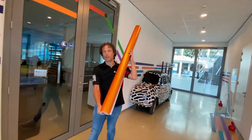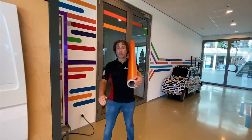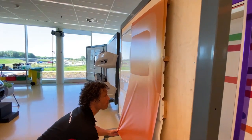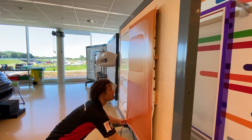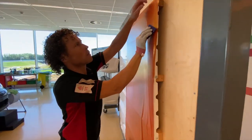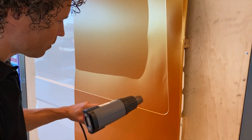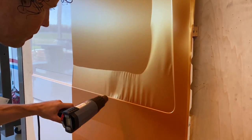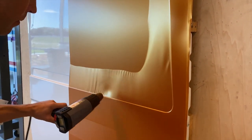I'm going to show you a few simple and solid techniques. There are other methods that you can use, however what I'll demonstrate will put you on the right track for sure. During the installation you will often introduce tension into the material by squeezing or simply stretching the film. This tension can always be removed by using heat. Important here is that you evenly warm up the film to a temperature of 40 to maximum 50 degrees Celsius and keep the heat gun in motion.